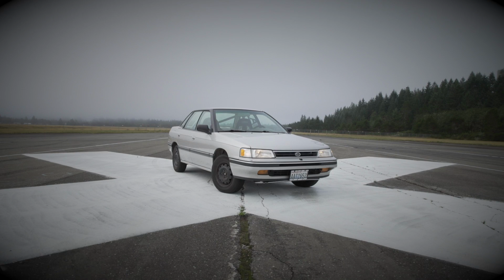You were stranded, but you didn't do any major, catastrophic engine damage. Nowadays, if you let one of those items go, it's all over with the screaming and shouting. So as such, we rarely do a timing belt without replacing all of those timing components. But on the older cars where you could get away with it, you did get away with it.